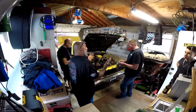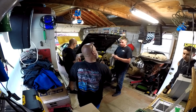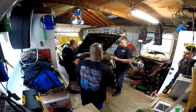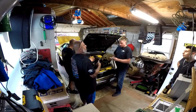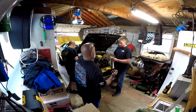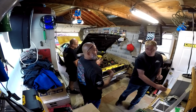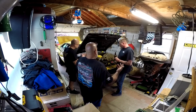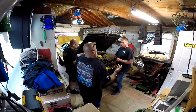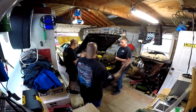It was leaving great. Second gear coming in, pull. I'm like, wow, I'm back. But going second to third, for some reason, I think it had a lot to do with the tranny too. I don't have a manual valve body in there. It's an automatic feature, so it's kind of delaying a little bit. So I think I was hitting the rev limiter before it engaged to third gear, but it won't do it on motor. Me and him took it the other day. We blasted it first, second, third, and no rev limiter.